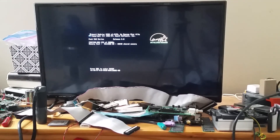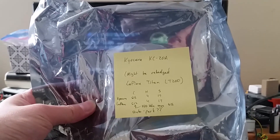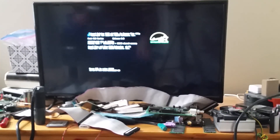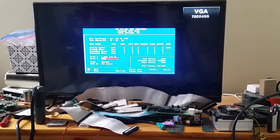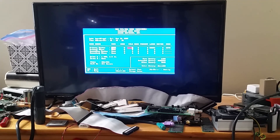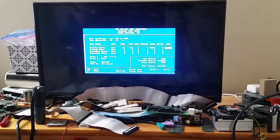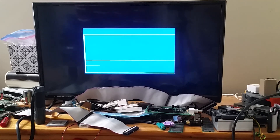I have written on this bag here what the CHS values should be for this drive. It's going to be 615 cylinders, 4 heads, 17 sectors per track, so I'll need to enter that in manually. This drive also auto-parks, so I don't think it'll be necessary to do anything about that. Setting it to normal mode — there we go, capacity of 21 megabytes. Let's save and exit.